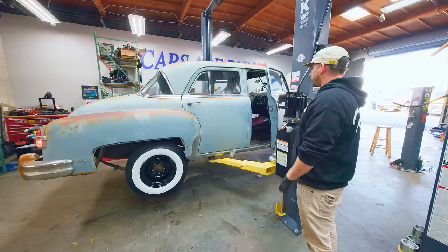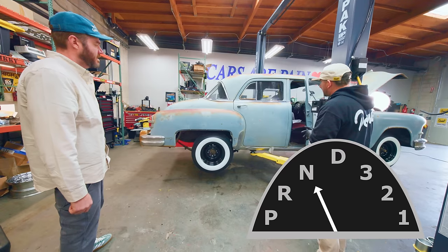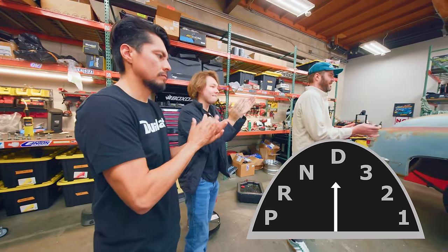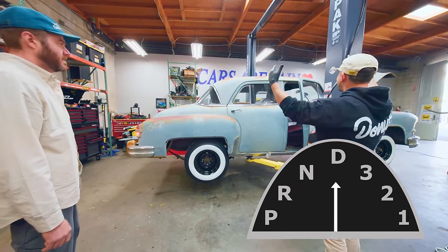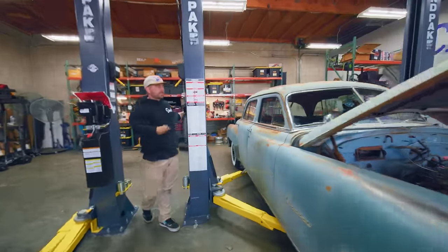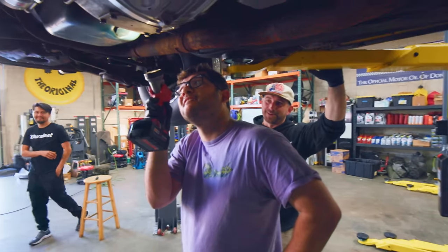We're going to turn the car on again and see if the wheels turn. Put it into drive — oh, we're moving! So right now we're just messing with the idle. We want to get it idling well when it's cold. I'm messing with the idle screw, which opens or closes the butterfly ever so slightly. It feels like it's where it wants to be right now. We also appear to have an oil leak — I think it's the rear main seal, which is a big pain, but that's something I can pay someone to take care of. The heat will hopefully expand the rubber and seal it up.